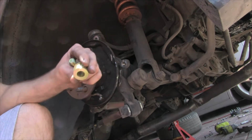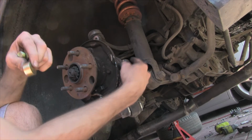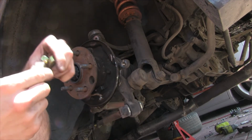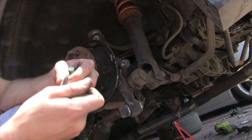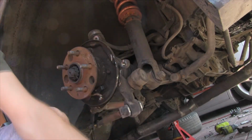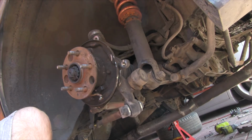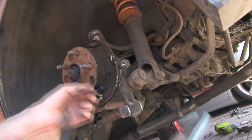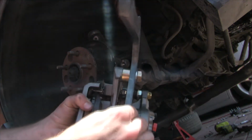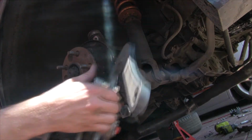But then on the side that you're adding the new caliper, these go into place because the bracket goes behind here. So these basically act as this. So it's just basically a gigantic washer to space it out. These also need to have the normal washer that it comes with on it. But now let's get the new caliper on the bracket, and then we'll install it. Alright, so like so, goes bolt, washer, bracket, the golden big washer, I guess, top and bottom.